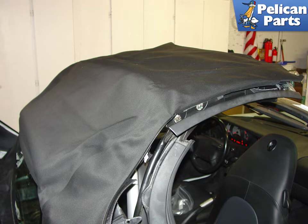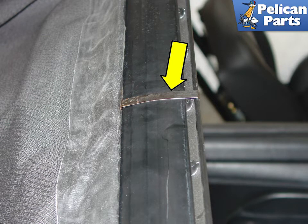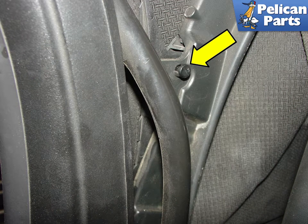Install the new roof onto the frame by first sliding the middle part into the rear channel. Cover the rear window with some paper and tape to avoid accidentally scratching it during installation. Slide the middle plastic channel into the roof liner — use a light bit of silicone spray on the plastic piece if you are having a tough time getting it threaded. Affix the middle plastic channel to the frame using the metal clip. Apply some 3M super weather strip adhesive to the channel and then screw down the top liner using the sheet metal screws. With the roof about 75% open, snap the slider pieces back into place on both left and right sides, reinstall the plastic rivets, and reattach the helper straps to the rivet if your new liner included them.